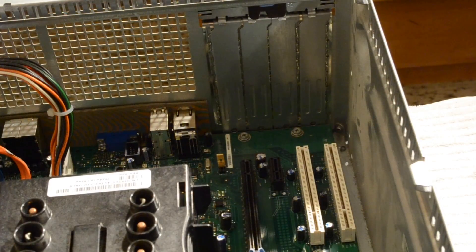Thanks Zach! Now that you have an idea of what graphics card will best suit your needs, it's time to learn how to install that card. Now while the card that we're going to be installing is the simplest to install, most graphics cards will install in pretty much the same way, with the exception of additional power connectors that need to be added. Our first step is to make sure that our computer is disconnected from the power, then we need to remove the case. With our case open, it's now time to find our PCI Express slot.